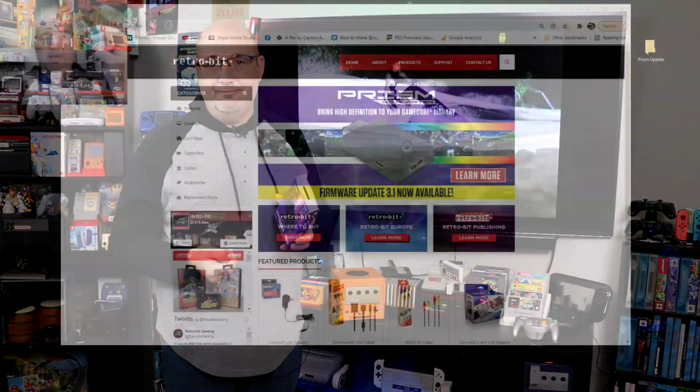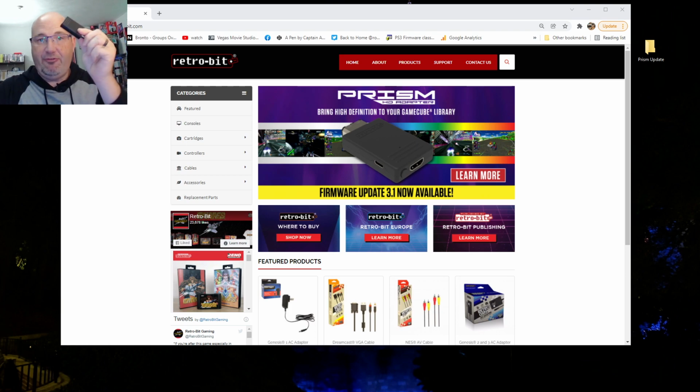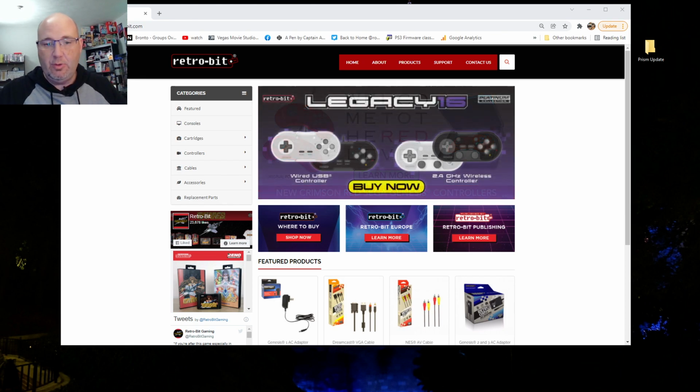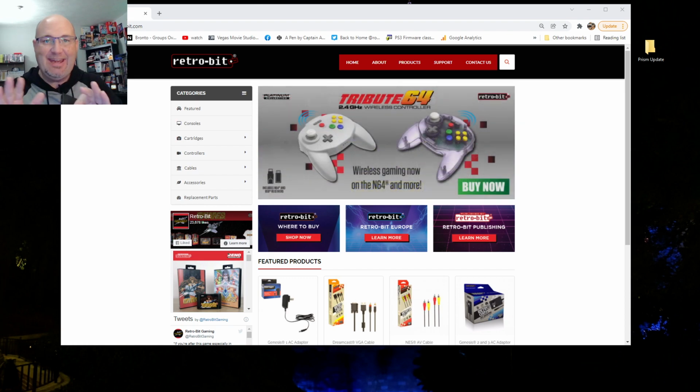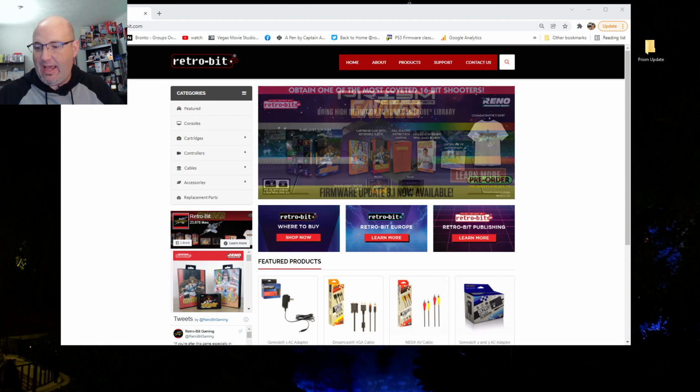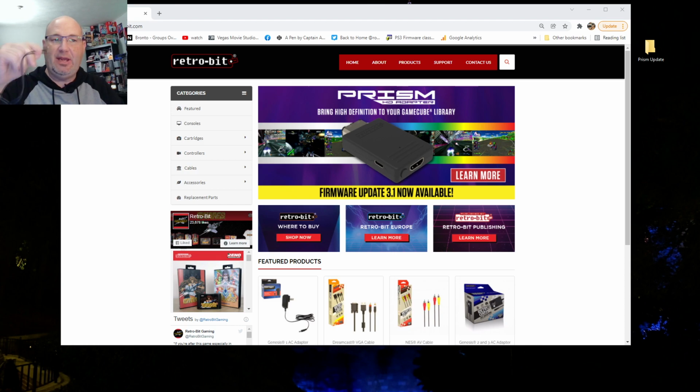Let's go get started. So we have disconnected our Prism HD from our GameCube that we were playing it on, as you saw in the intro. Now, one thing that we really need to make sure that we do before we do this update is we need to have a USB A to C cable that handles data. A lot of them will only handle things like charging for your phones and whatnot. We need to make sure that we have one that'll handle data, and I happen to have one right here.